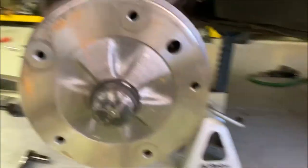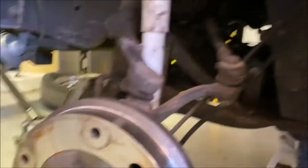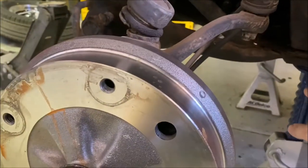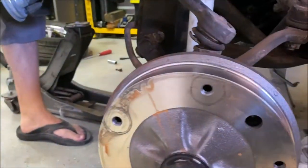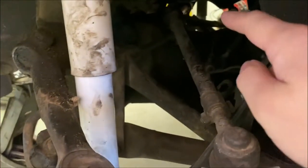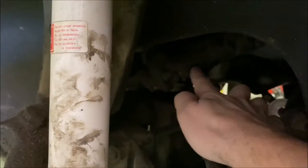Just a quick look — the Thing beam has some extra bracing on it that the Type 1 beam is not going to have once we put it in. We pulled the bolts for the lower bar out and we're actually setting our jack stands there, since all that's coming off. We're going to need to disconnect the brake lines so those can come off with the beam, and we'll have to disconnect some of the steering as well as the steering dampener and the steering shaft from the rag joint.